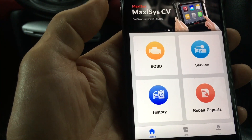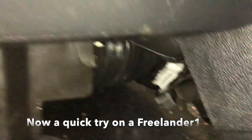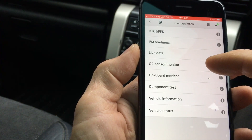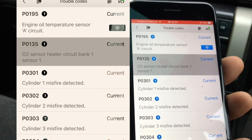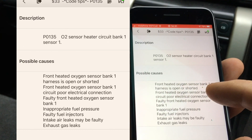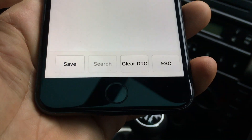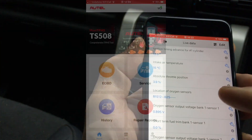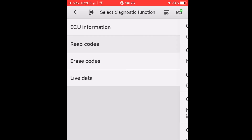Let's go over to my Freelander, which does have some OBD2 errors from when various systems were disconnected, to show you how it reports those errors. The Freelander OBD2 port is over here, easier to get to. Looking at the diagnostics, we have quite a few error codes — eight. I know my oil temperature sensor is disconnected, but let's see the descriptions. It's connected to the internet and telling you what the likely faults are — open and shorts on various things, faulty sensor. It's a little bit more than you get on cheap OBD2 readers where you have to look up the code yourself. Clearing the error codes is just a matter of tapping on that feature. With the engine running you've got all this live data you can map on gauges. And although there's no auto bleed for the brake system on the Freelander, you can still access the ABS module and read off all the CAN bus errors.